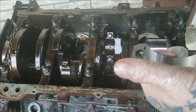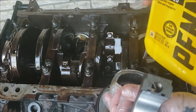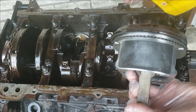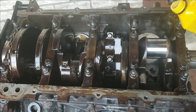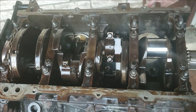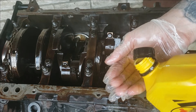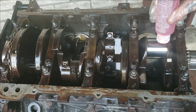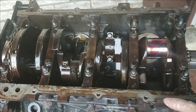Everything feels even now, which helps with the install. Next step, oil your rings and stuff up good. I just use some dollar store engine oil — just take it and pour it over the piston. Just lube everything up, your wrist pin and everything. Also put a little lube on the bore — you don't need much because we've also got assembly lube. Make sure your glove is clean, and lube the inside of your cylinder walls. Put some oil in your hand and take it, then put a little bit of assembly lube on the rod journal — you can never have too much.